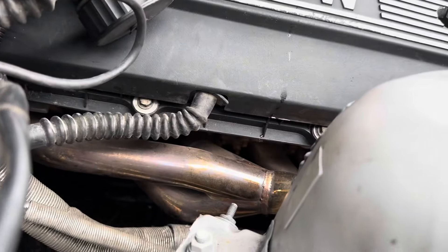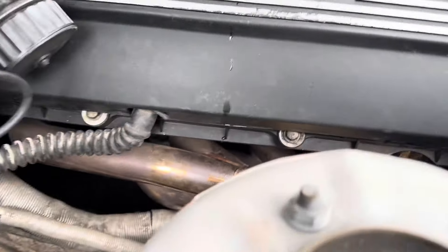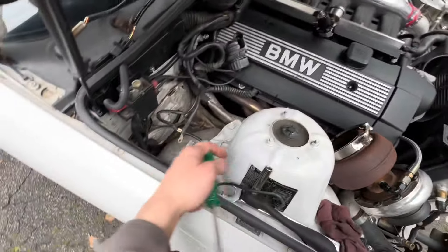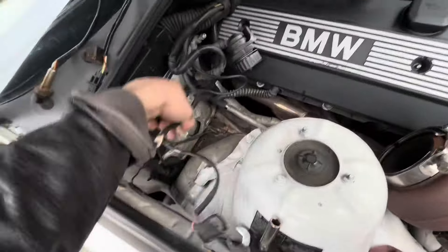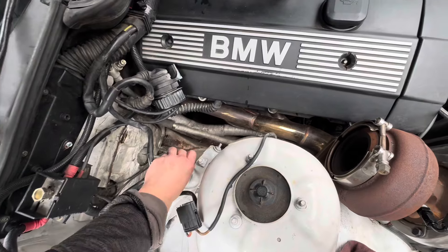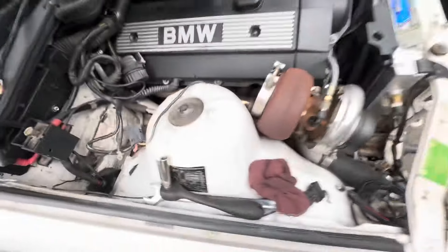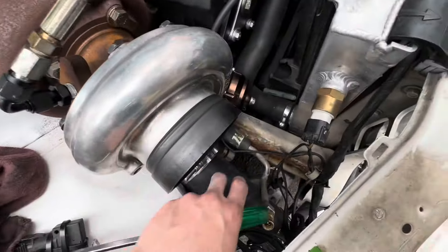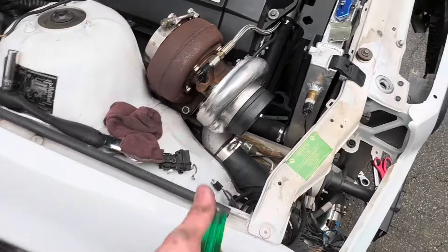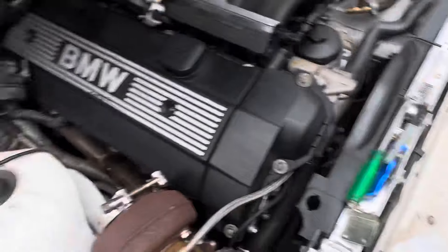I can see a loose nut on this manifold and I was kind of worried about that because they're very hard to tighten on these cars. I'm going to try and tighten the ones I can reach. I started just cleaning up some wiring because there's so much extra crap back here, and I need to make a hole for the boost reference and the AFR to go through. Eventually I'm going to have to pull this turbo and sand all this down, make sure it's not bare metal and doesn't keep rusting - just get it coated with something.